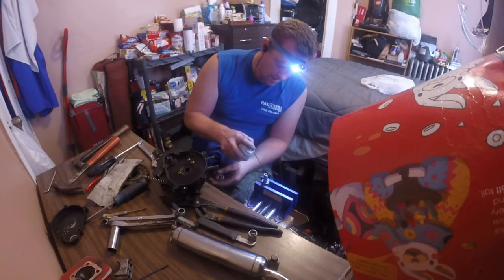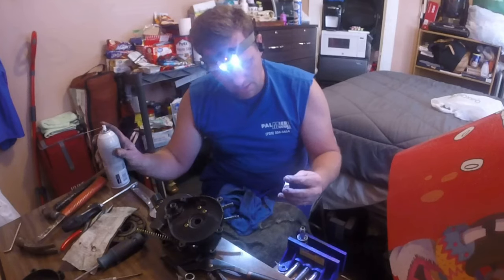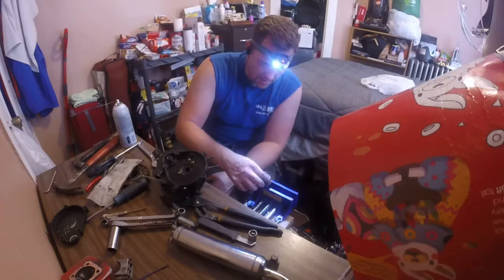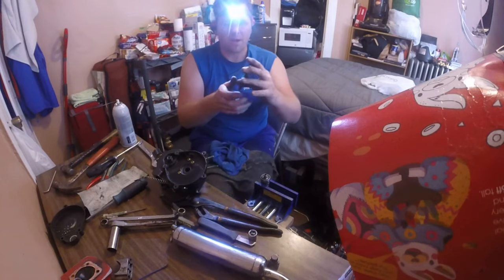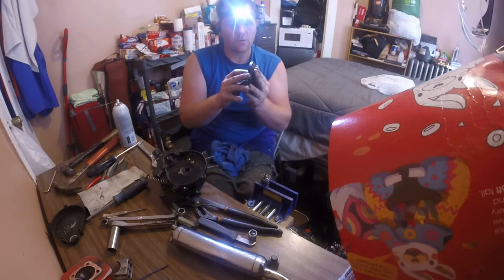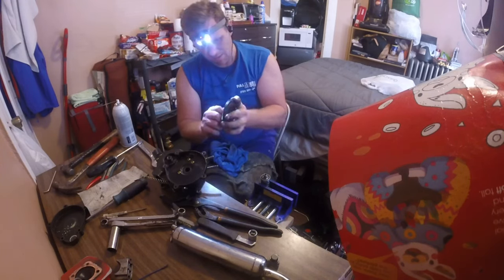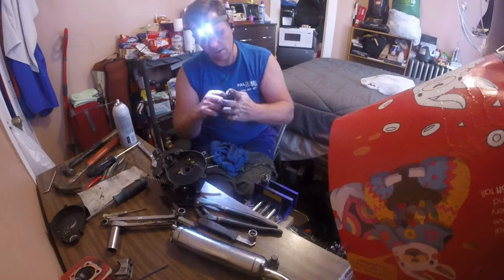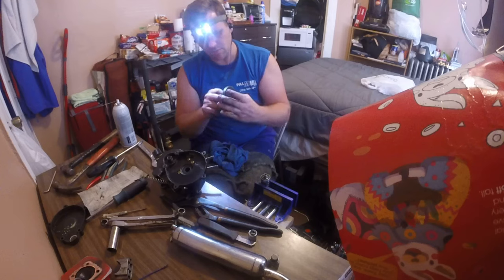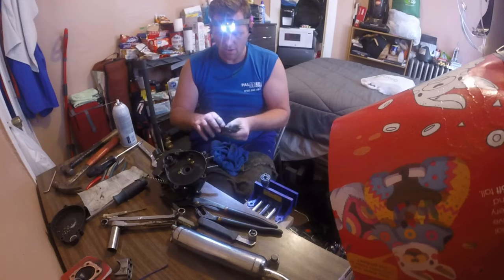But I had my inklings that it was the bottom end. Then I started thinking it might be the clutch. And it's tore up, to say the least. The clutch basket, there's bearings inside. And if you spread it and get the gap, like down in here, there are definitely maybe missing bearings. The gap is big enough, definitely, that a couple could squeak out with the play, especially when it heats up. Bearings are super small, and the gap is quite large. It's also very hard to turn.